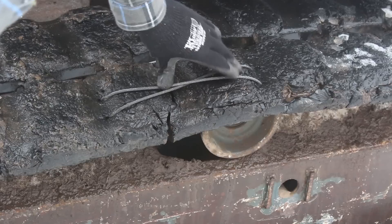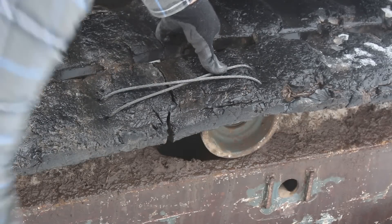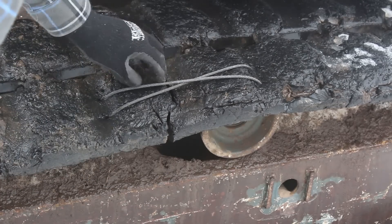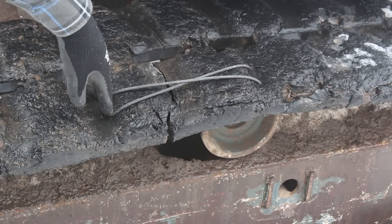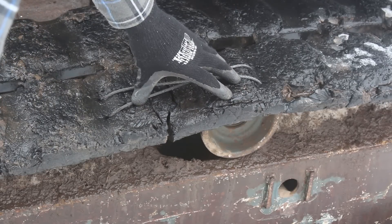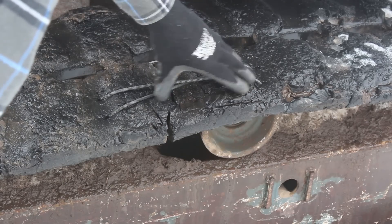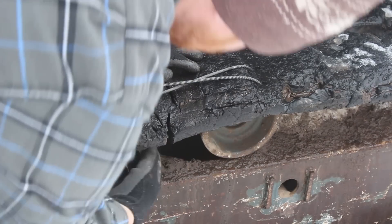What I came up with is: right where the metal cleats are — these metal cleats are infused into the rubber track itself — you just drill a hole just barely on the other side of those metal cleats. That way these cables will grab hold and actually wrap around those metal cleats so they don't tear a hole through the rubber, but they'll be right up close to those cleats.